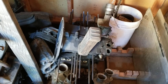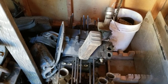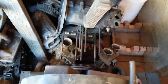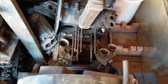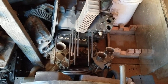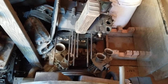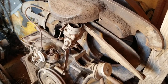One of the things I don't like, if you're going to go bulletproof, you want it to be reliable, hop in it, start it up and drive it, is putting on dual carbs, especially Webers. These things are great for performance, but for daily driving, if you're talking about bulletproof, they constantly have problems with the jets clogging, and you're going to be adjusting them all the time. So as far as bulletproof, I would say steer clear of the big carbs and stay with the stock, either a single stock-type carb, or I like a two barrel on mine because I'm going with a bigger engine.